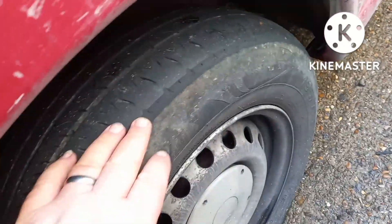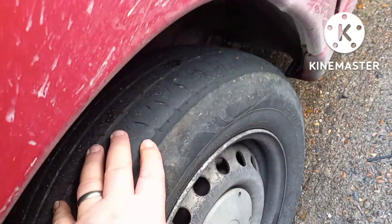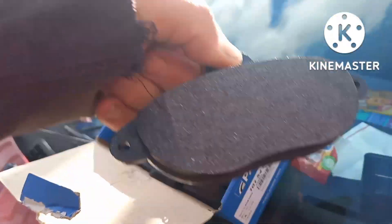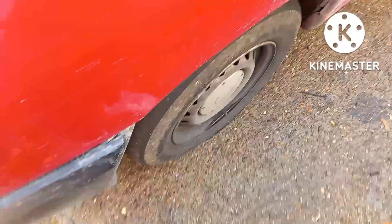Good morning, you join me at Poppy the van. I've noticed the outside edge of a tyre is just wearing there that I didn't know about, so the tracking must be out. And I've got to do brake pads — I have some new ones here, and this is the job of the day.